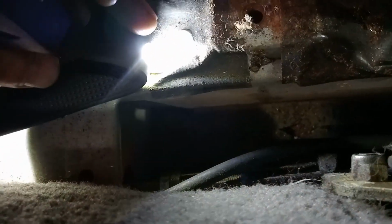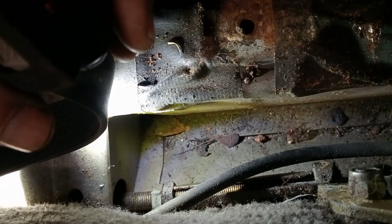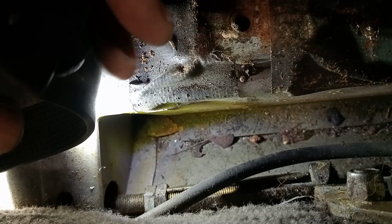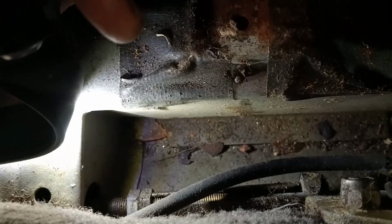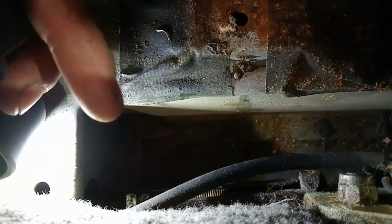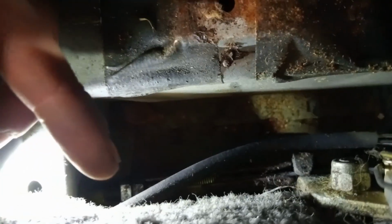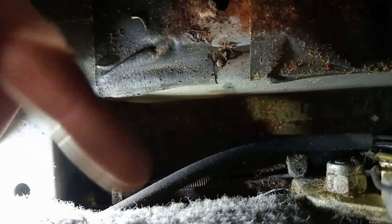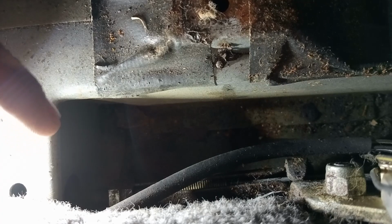Okay, and then down in here behind the lever, you'll see these 2 lock nuts here in our thread. So they are a 14mm nut, so you need 2 14mm spanners. Turn both in anti-clockwise directions on the thread so that they unlock from each other. Okay, and then this front one, we're going to tighten that up so that we pull the thread out this way in order to tighten the cable. So that first nut, once they're unlocked, we'll be tightening towards the front of the car, pulling that thread tighter.